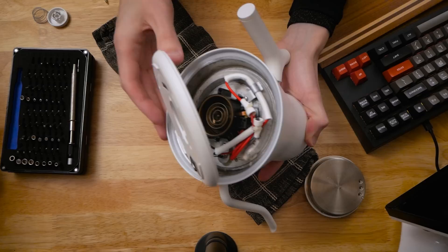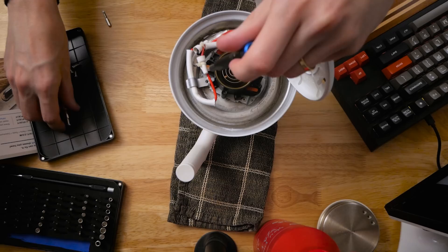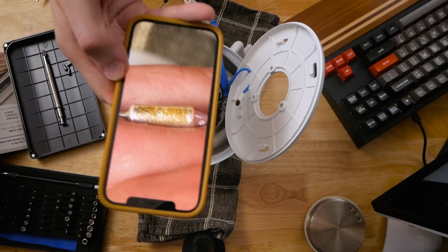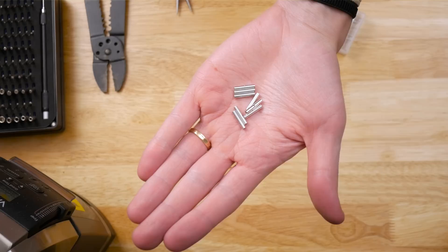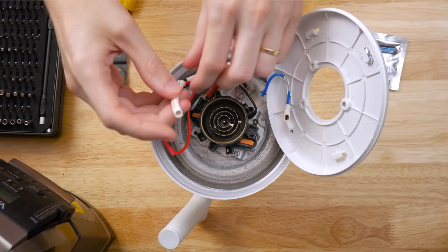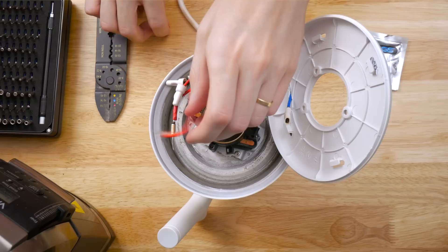A small Phillips head screw holds this one in place. This screw is really tricky to get out — if you have one of those little grabbers, it makes it a whole lot easier. Now you should be able to move the sheath over to reveal the fuse. I took note of the temp rating on the fuse and picked a few up on Amazon — they were about $7 for a pack of 10. It's a little while later and we're much better lit this time. I've got my replacement fuse and crimp connectors. If you have a multimeter and want to check your kettle before picking up all this stuff, I'll link a video in the description to guide you through that. You may notice I already have a new fuse in there held with electrical tape — I used that in the meantime while waiting for the fuses. It works in a pinch, but I wouldn't recommend it.